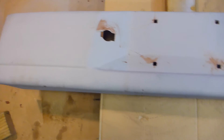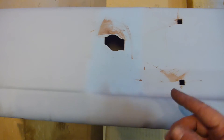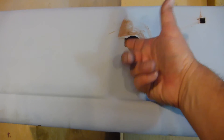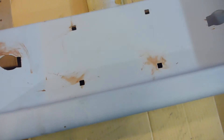Those streaks you see are just where on the inside of the bumper I painted with Rust-Oleum Rusty Metal Primer — it's a red product — because it's good at handling really bad rust. It wasn't terrible in there, but it was pitted. That's what I used on the inside, and then just regular automotive primer on the outside. There were a couple of drips from the inside out and as I wiped them off they just smeared a bit, but this is all very well prepped and primed.